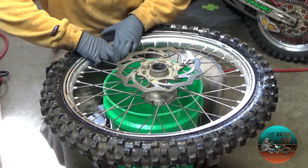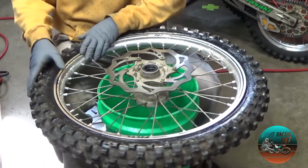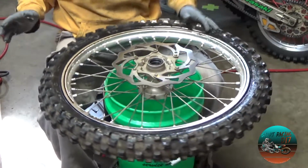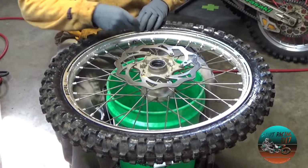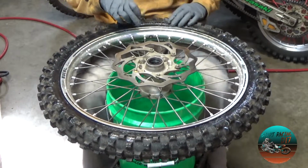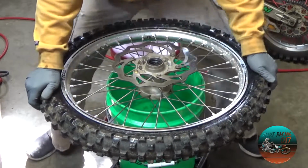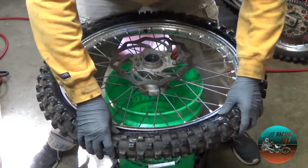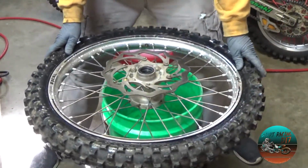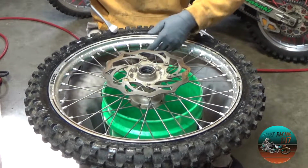Now, you want to push your rim lock in to make sure that it'll move, number 1, so that you can break everything free. So now, I start on the rim lock right here. That's where I'm going. That's what I do. So before I put my spoons in, I'm going to make sure I push down on this end and make sure I get that side all the way down. I got the tire down into the rim.